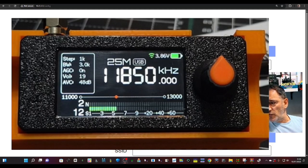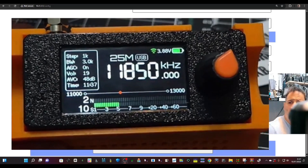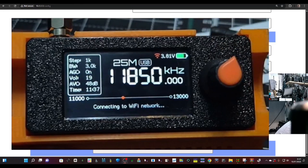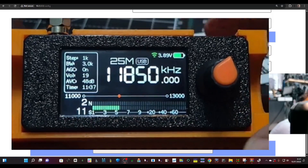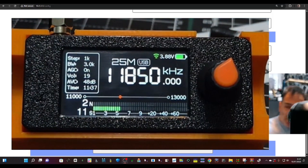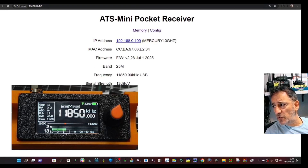When you're not connected, the Wi-Fi is going to show red, but red does mean it's sending out its credentials. What I had to do — because it has connected now — was press the menu, go to settings, go to Wi-Fi, and then actually press connect. As soon as I did that it changed the new IP address to 192.168.0.109. It also says you can try admin.local — I'll try that — but anyway it's using that IP address which is working just fine.